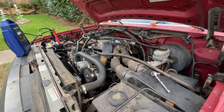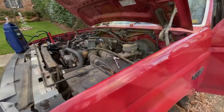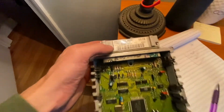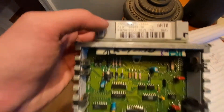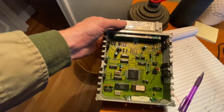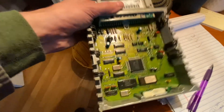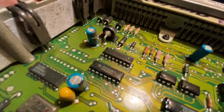Any other Ford truck problems, I think I've nailed most of the troubleshooting — let me know in the comments. Here's the old PCM. If you're going to make this swap, you have to make sure you get one that lines up serial number and part number wise with the truck you have. I believe the model year range for this is '93 to '95 or '93 to '96.